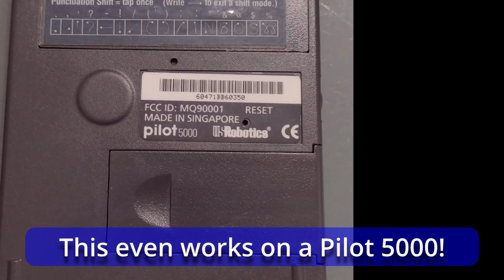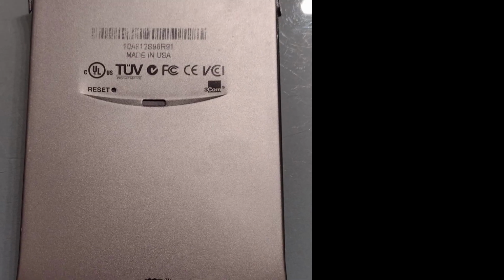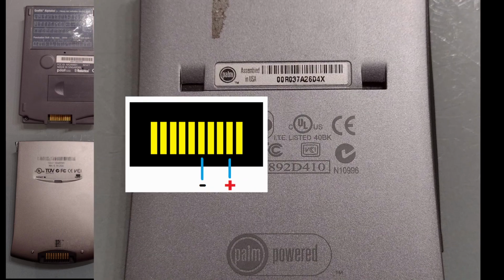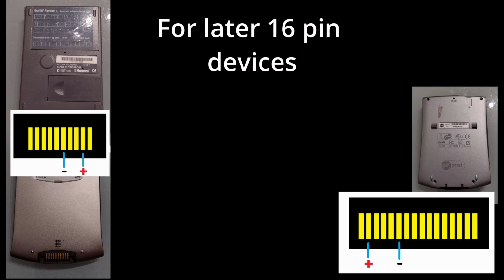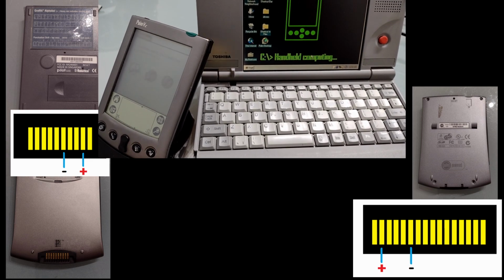Before you go ahead with this, it's important that you know that because we're connecting 2 wires across an LED, there are a couple of unwanted side effects. The first is when the Palm is switched on and in the cradle, the LED receives a small amount of current and glows very faintly. The second is that when you hot sync, it acts as if it's a drive display, so it shows you the data transfer rate. I'm sure there are other side effects.